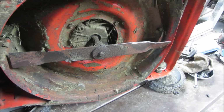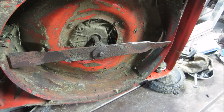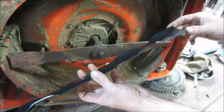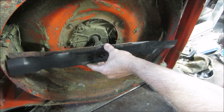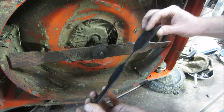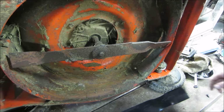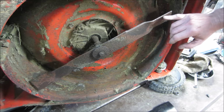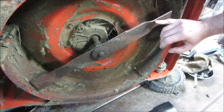So I decided to flip it over and look at that blade a little bit more, just because it seems kind of out of whack to me. This right here is a regular Craftsman blade for like a Craftsman garden tractor. I'm not sure how well it's going to show up in the darkness here, but you see how this edge is ground? This is how this blade would be installed. Same edge, same area, but let's see how the grind's on the top side of it, not the bottom side of it. But what has me, it must be just the way it is. The corners are completely squared off. Usually when a blade wears, you'll start seeing the very corner of it wore away, and the more it gets used, the more that gets down to like a butter knife or a kitchen knife as it goes through life.